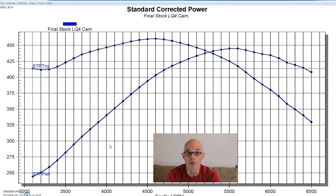It's also important, obviously, to have the right valve springs, and there's a lot of good valve springs out there. Sometimes we run that single beehive spring from Comp at 26918, although more often than not we like to put a good dual spring in. Brian Tooley has a good dual spring, the guys from Summit offer one, Comp offers one. There's a lot of good stuff out there. Just make sure that you match the spring to the camshaft and the intended RPM and usage, because the spring rate is very important. And more spring pressure is not the answer. You need to have the right spring pressure for your camshaft and RPM, and especially the cam lobes. Those things need to be stable. So pick the right spring for your cam, and your cam experts can help you do that.